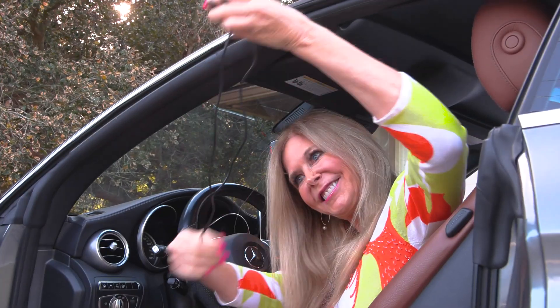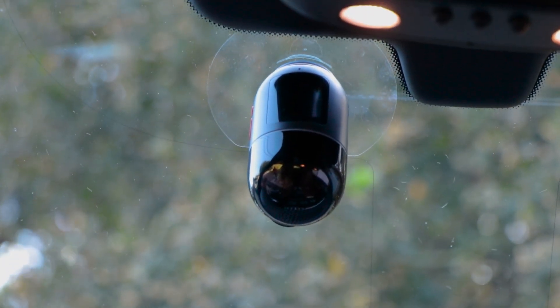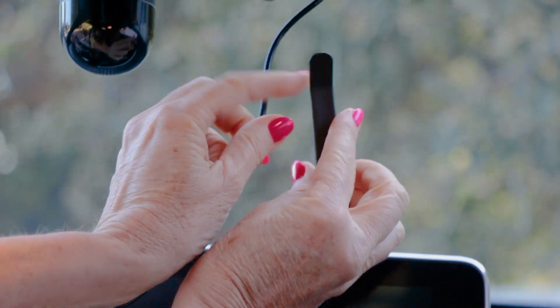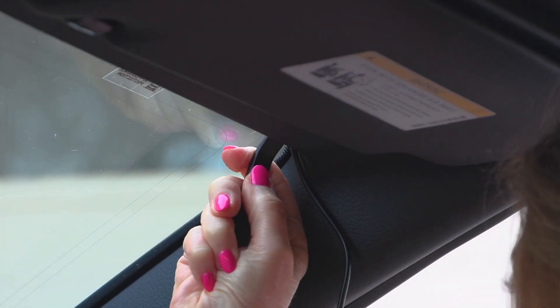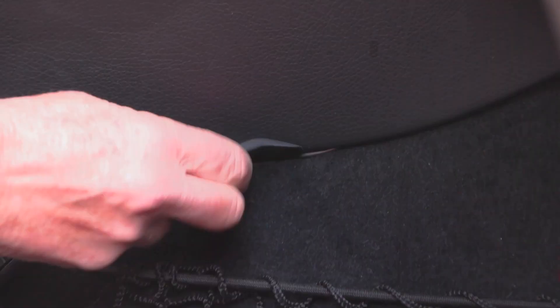There are two different ways to install the Omni. The first one I'm going to show you is installing it to my cigarette lighter — that's the quickest way, but it won't get the parking features. I'll show you how to do that anyway because maybe you just want the in-motion driving dash cam. I needed to connect the wire for the power supply, so I ran the power cord on the top of my windshield. They have this little gizmo called the wiring crowbar that helps you shove it into the molding around your windshield. I was using my fingernails and the crowbar and it was going down all around the edge — it only took five minutes. The directions were great so I could do this easily. I went all the way down and around, underneath my dashboard, and brought the wire over to my cigarette lighter.